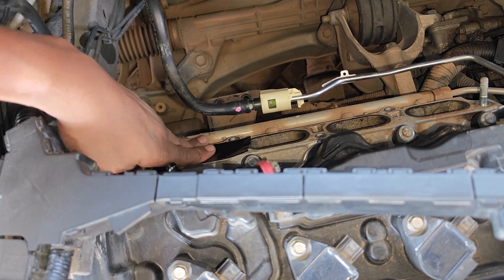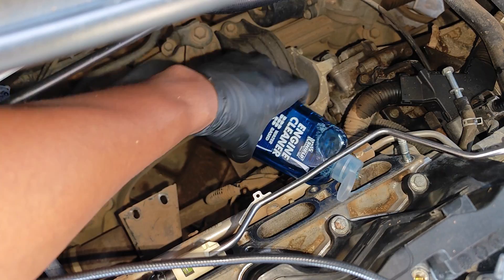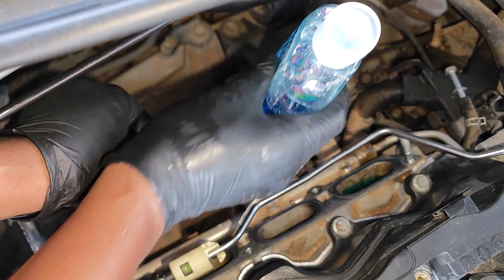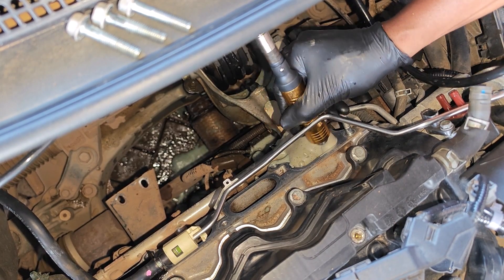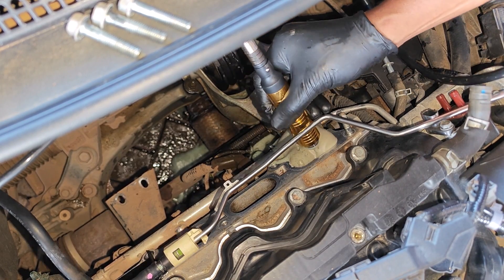The open valve is at this end of the engine, so I taped it off. For the drill method, the first thing I did was to fill the intake port with the water-based engine degreaser and then attacked it with the drill. The main reason for using this degreaser first is that I found it to be more effective at removing varnish stains than carb cleaner.